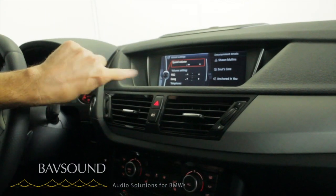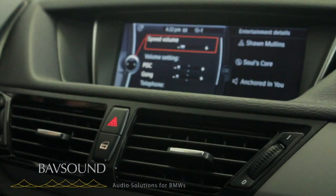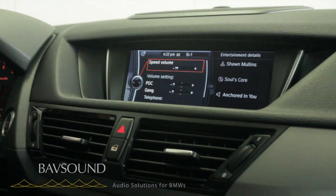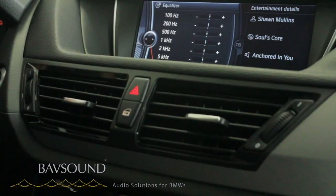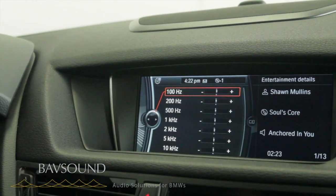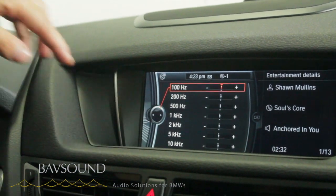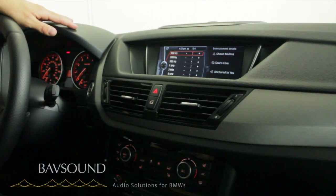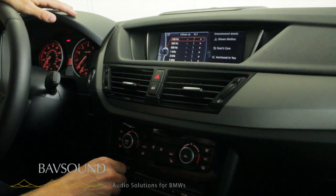Volume settings — speed volume all the way down. Do that in all cars: speed volume down, because as the engine RPM increases, the system artificially pulls bass and lower mid range out of the speakers to prevent distortion. That's no longer an issue with our speakers. EQ — I've got it flat. Again, if you're in your fifties or sixties, maybe you want to boost the 10K a little bit. For the rest of it, this largely should be flat. If you're hearing a little distortion in the low end with certain tracks, come up into the 100 Hertz and bump it down a notch or two. But by and large, our mid ranges kick in just below that five, in the range between 200 and 500 Hertz. So let them do their thing — let it be flat, let the signal be uncompressed, and let them jam. And that's kind of the settings — there's really nothing more to it. You can go wide open at this point, there's no distortion, up until the very, very top end of things.